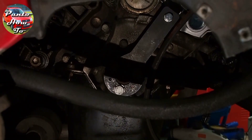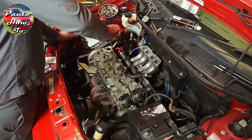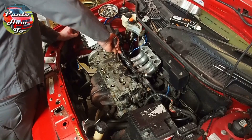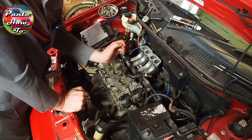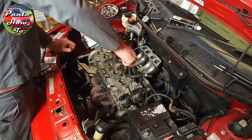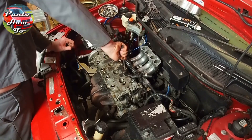For this next part, make sure that your timing tool for the crank is bolted in position — this locks all four pistons in the midpoint of the stroke. As you bolt the cam carrier down it's going to start to press on the valve springs and slowly open some of those valves. The last thing you want is a valve making contact with a piston before you've even finished rebuilding the engine, completely writing off all the work you've just been doing.